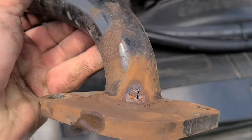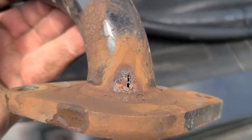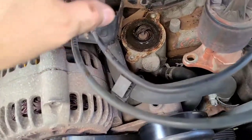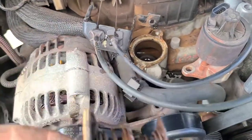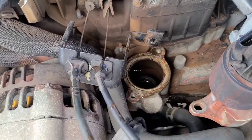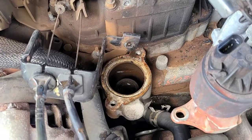Check that out — that's why we got a leak. So we'll go ahead and take that out and throw it to the side. The thermostat here, we're going to remove that also, because since we've got it taken apart we may as well replace it. So we got that out as well. Now we'll just go get our new parts and assemble this thing back in reverse order.